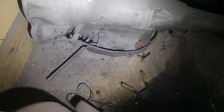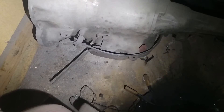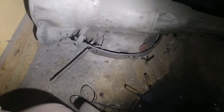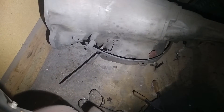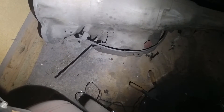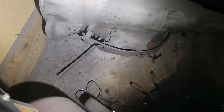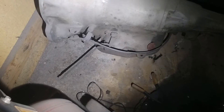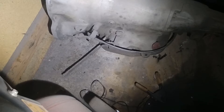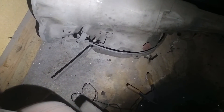This 65 trans was sort of the only year they did this with the slip yoke. After that, they all went to the linkage system where the kickdown lever is - they had an extra lever on there for the shifter which did park and everything. Because this is a '66, it never had that system, so it doesn't have the rest of the gear to make it work properly. I've been thinking about shortening the outer cables and trying to make something to hold them and work off a lever system, a bit like what's on the kickdown.